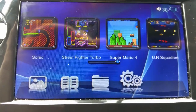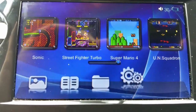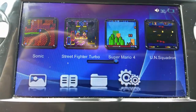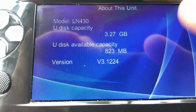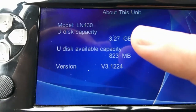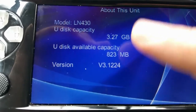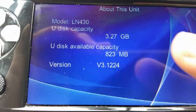Mobile level gaming. This is an impromptu video answering a question I've gotten a couple of times: can a larger than four gigabyte card work as the internal memory card? This device comes with a four gigabyte card, as shown under system info. I'm going to take it out, flash the backup image of the original software onto an eight gigabyte card, place it in, and see if it works. Stay tuned and I'll show you the flashing process.